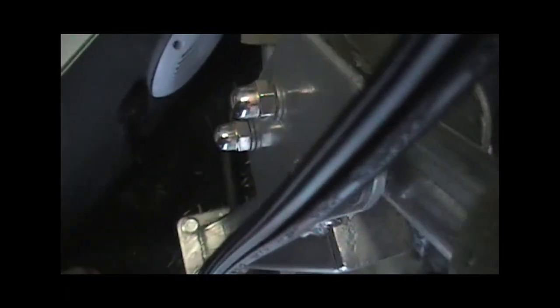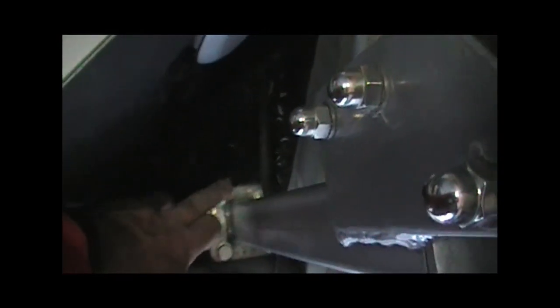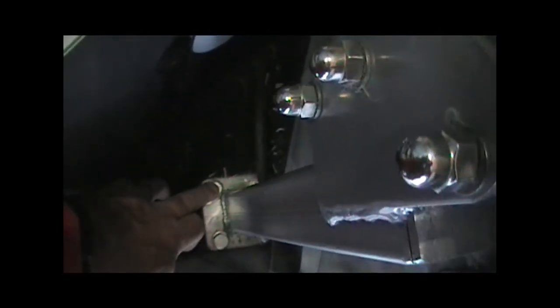That base plate sits back from the bolts. If you take the furthest bolt back into the middle and draw a line straight from there, it's approximately 405 to 415 millimetres from there to where that plate needs to start, centralised in there — I've set this one up at about 410 millimetres. You do have to be careful because running underneath across the back is a chassis outrigger, which will cause problems when you go to screw it down. 405 is the absolute furthest forward it can go, and that's really close to the outrigger, so just move back slightly from there and you'll be better off.